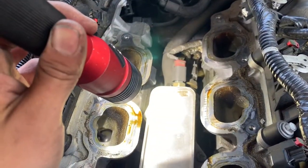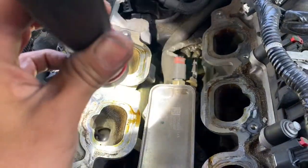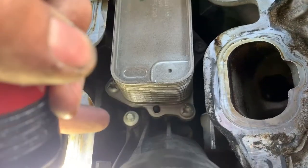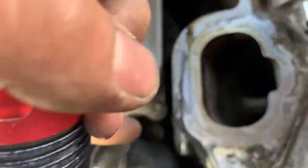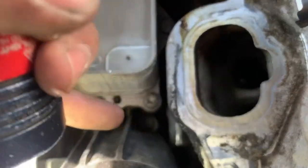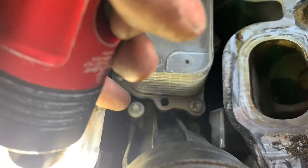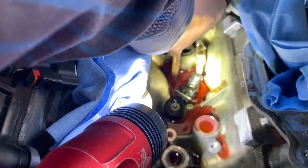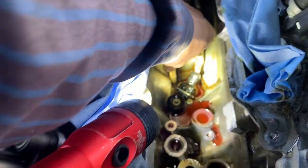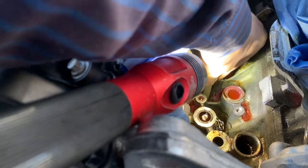So before I start working on the filter housing, I'm going to cover up all the head holes - I don't want to drop anything inside. I think there's five or six bolts holding on to the whole housing. That's one, two, three - that little one right there - four, five. Not the big one; you don't want to take the big one out, the little one is the one you want. I've got my suction going to remove the fluid - this is much faster than putting towels trying to dry it up.